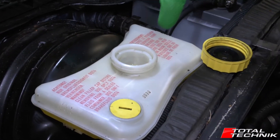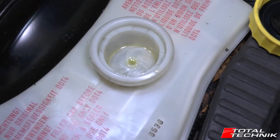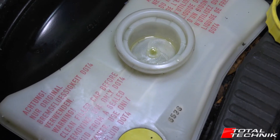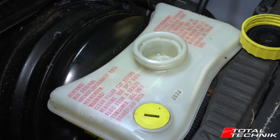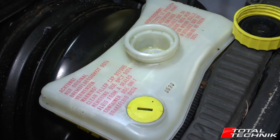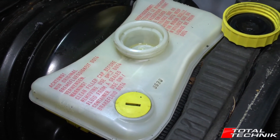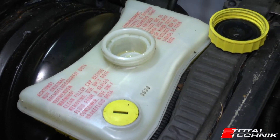Now very often these reservoirs have filters in the top, which can be quite hard to get out, so I'm going to leave this one in. If your brake fluid is very low it can be hard to perform this test - mine's about halfway so we should just about do it. Obviously if your brake fluid is low it's going to need topping up anyway, so you'll want to top it up, give it a run around to make sure the brake fluid has circulated around the system, then conduct your test.